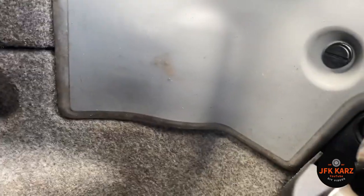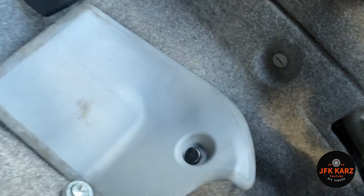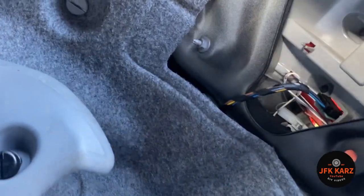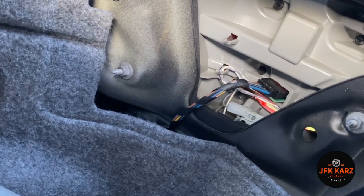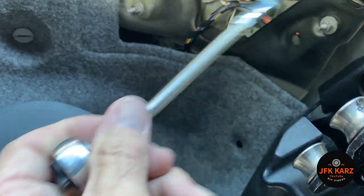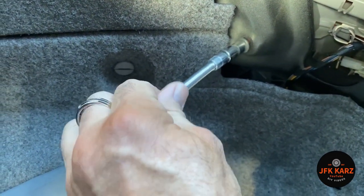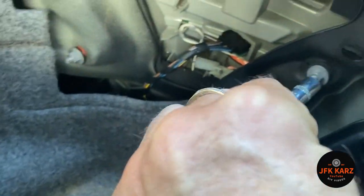For access, there's a little case cover on the back, so we take that off with a flat-edge screwdriver. Then turn it to the vertical position — that's unlocked — and this plastic here you just slide it this way and it comes out. Then we've got our three 8mm nuts to undo, then disconnect it, and that should release the backlight. Once you've got most of the tension off you can do it pretty much with your hands — probably best in case you lose the nut.